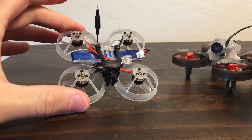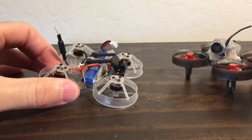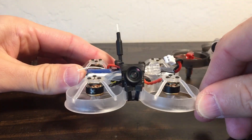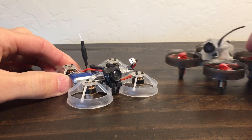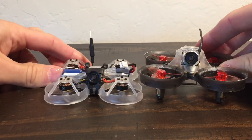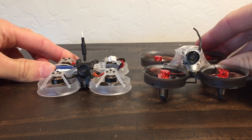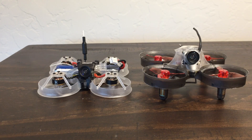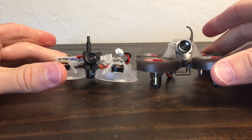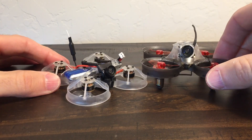I've noticed some definite benefits. With this versus the Goober canopy, I'm saving at least half a gram, maybe 0.75 grams in weight - and with thinner zip ties you can get that down even further. The other thing I'm noticing is that even compared to a brushless setup, your height profile is so much smaller. I've noticed a big difference being able to get through tight vertical gaps - it just fits in spaces that are much harder to get through.